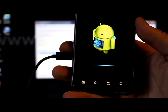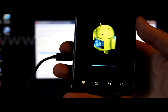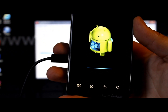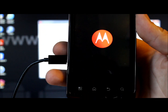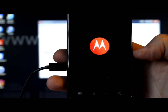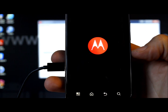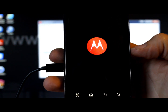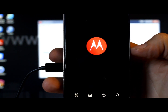The radios are just about done. The whole flashing process is a good 15 minutes at least — it can be nerve-wracking the first time, but if it's progressing like this you should be fine. Do not unplug the USB cable. The device has just rebooted out of Android recovery automatically and will now go through a full reboot.